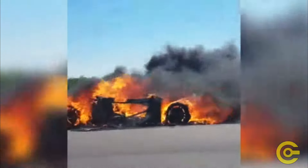Huracans and R8s are pretty known for catching on fire. We feel that if you're going to modify this car and put twin turbos on it, you also need a sufficient fire suppression system installed. We won't let a car leave our shop without that installed. There are too many instances where an oil line for the turbocharger drain, fuel injector popping out, a DI injector popping out — too many opportunities back there. The engine bay with the hatch shut is extremely hot, so it's a recipe for a fire to start, and with it being behind you, you don't even know that the vehicle is in trouble.